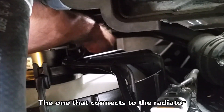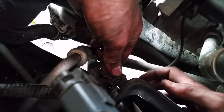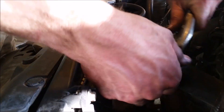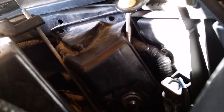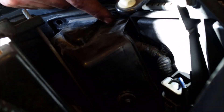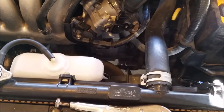Reconnect the connector at the bottom, then plug in the upper connectors — these two connect back together and that slides back on. Push this little peg through; you may need a little help — use a screwdriver to reach down in there and hold it from the back so you can apply some force. Reinstall these two little clips. Then top off any coolant you may have lost from removing the tube and reservoir, and you should be good to go.